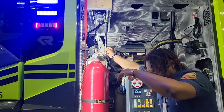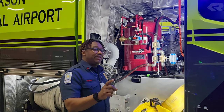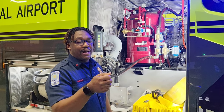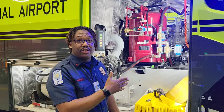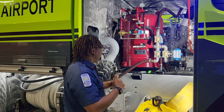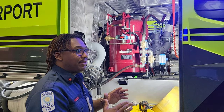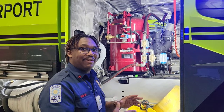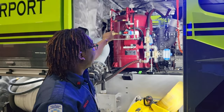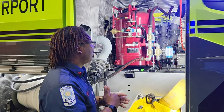The nitrogen bottle is now off. Now we're gonna switch and go to the other side. One thing I forgot to mention: before you start, make sure you turn your power on on the truck — you don't have to start it, but make sure you've got power to the truck. So we just turned the nitrogen bottle off, but there's still nitrogen in the system, in the lines. That's the pressure we're gonna use to shoot pressure inside the tank — it's like a shot of pressure that's gonna fluff it. We're just using the pressure in the lines; that's why we turned off the bottle.